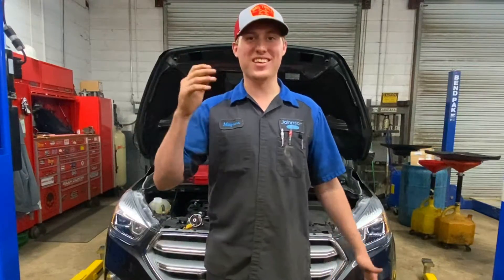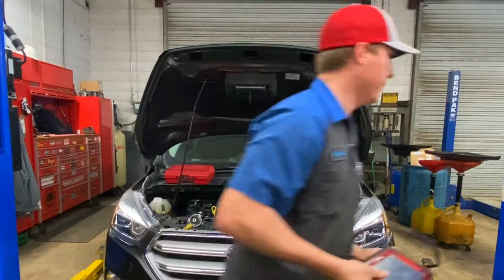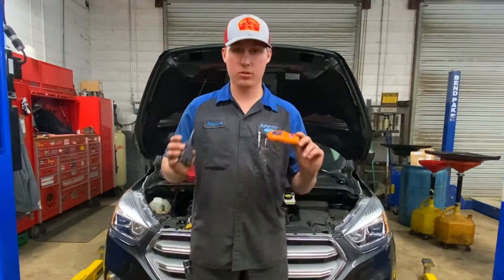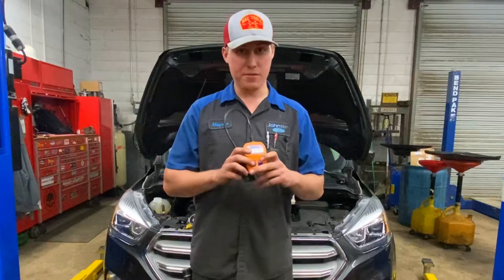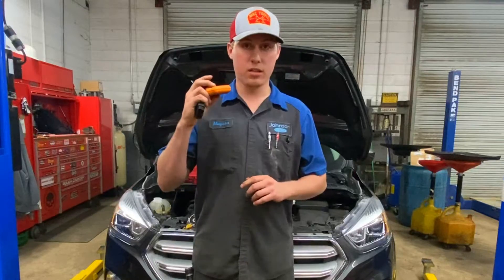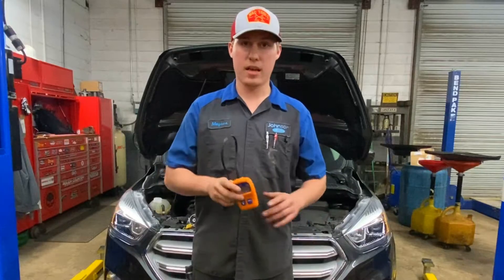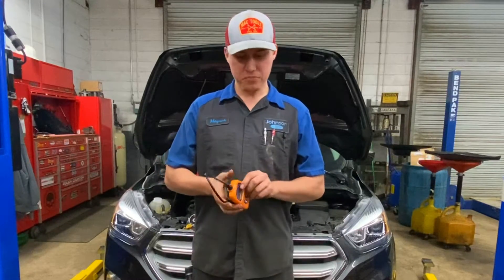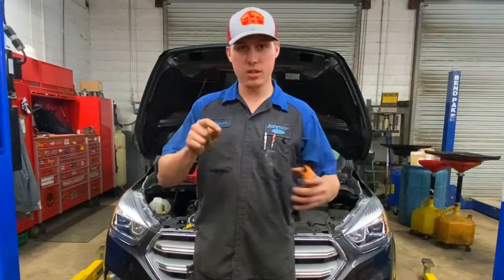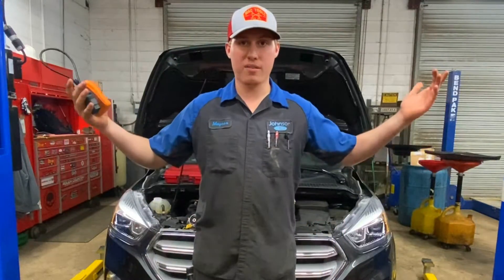The fourth thing is optional but I really like it. Not a $10,000 Snap-on scanner — just kidding. An Actron OBD2 pocket scan tool. These things are really cheap and super easy to use — it has two buttons. It pulls engine codes only: no ABS, no airbag lights, none of that. It doesn't give you descriptions, so you pull the code and then Google it. You'd be surprised what the internet will tell you.